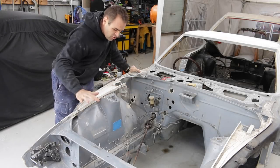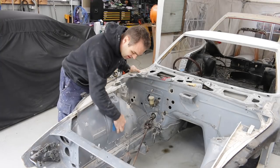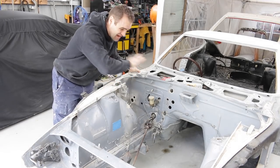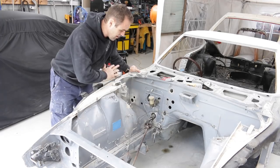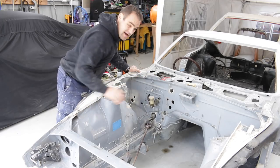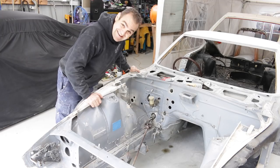I've stripped out all the wiring out of the engine bay here and tidied some things up. You can see I've masked up the compliance plate here, so it's now just a matter of going through and sanding the whole thing back. I'm just giving it a light scuff with 320 over everything, get it all scuffed up ready for some paint, and then I need to do some light masking. Most of body work really is just lots and lots and lots of sanding.